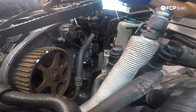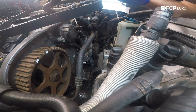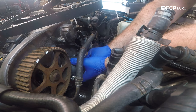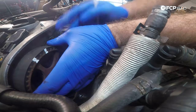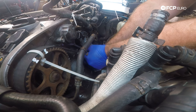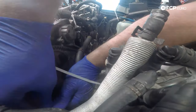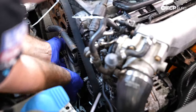Now it's time — we have the belt off, the belt's marked. I'm going to go ahead and put the mechanical tensioner on. Most of the time, at least in our kit, the tensioner is going to come with a new bolt and a new washer. The washer is going to go behind the pulley. We're going to install this loosely and then get the belt in place. Something I always do since we're going to be moving this around — I'm just going to zip tie the belt in place. Now we're going to bring it down around the water pump, keep it nice and snug, and go down underneath and line up the crank. Now we're going to take the belt, keep tension on it. So now we're going to go ahead and install the hydraulic tensioner now that our belt is on.